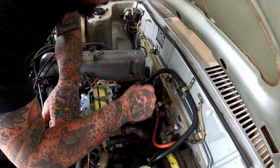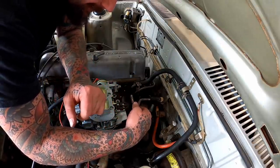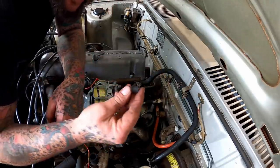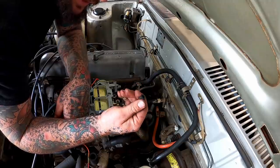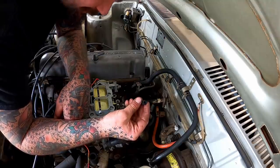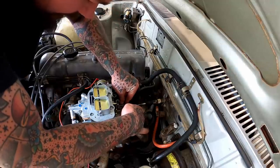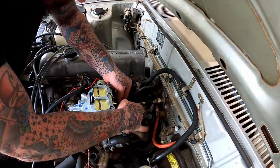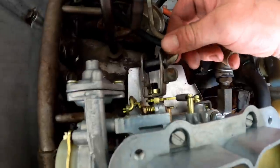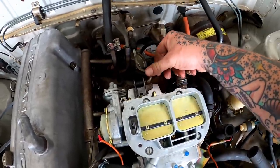First video with old Aunt Dorothy here. All this thing had in there was a spring, no kind of cotter pin, even though there's a hole. Obviously it's missing some stuff. So let me show you the simplest way I just thought of retaining this. And this is about a half inch of that quarter inch fuel hose. I put a little drop of lube inside that hose because I know this is about to be a tight fit on her. Now looky there. I think we're all right there. I think that'll work, everyone.